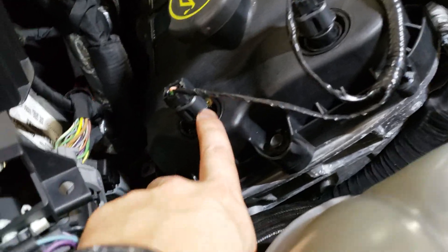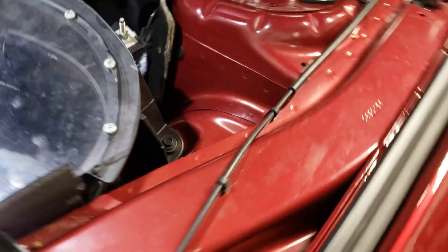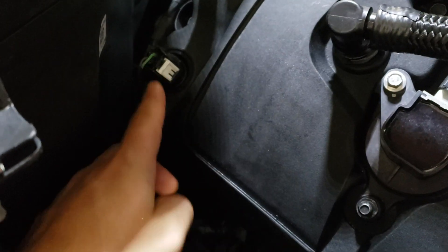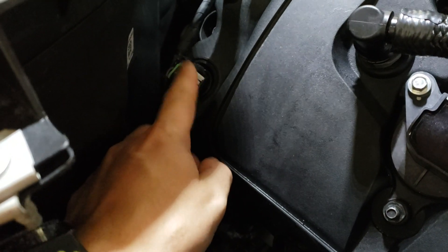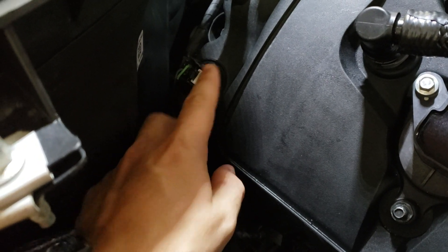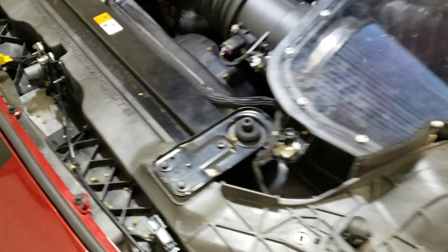In my experience, the most likely failure is the one further down — this one here on the passenger side, or the one down here, is the most susceptible because it's near the air box. If you're moving your air box around or anything like that, this wire is very susceptible to getting pressured and bent, so keep that in mind.